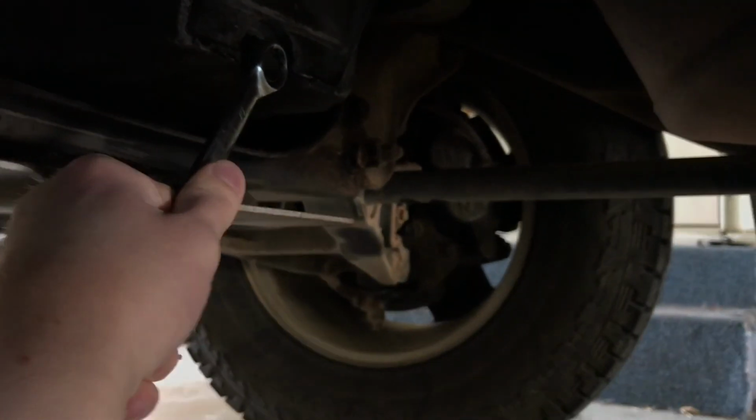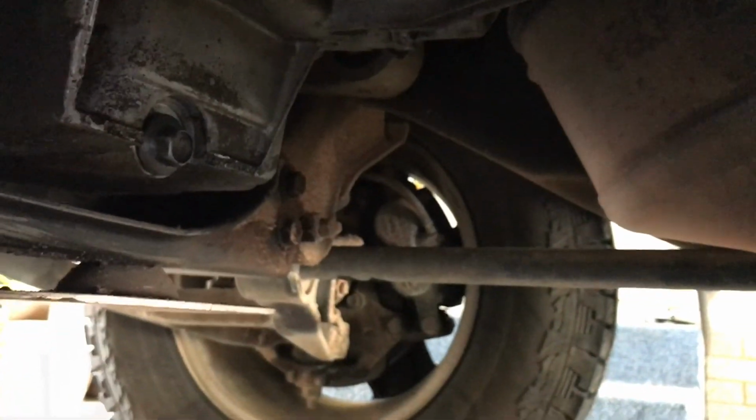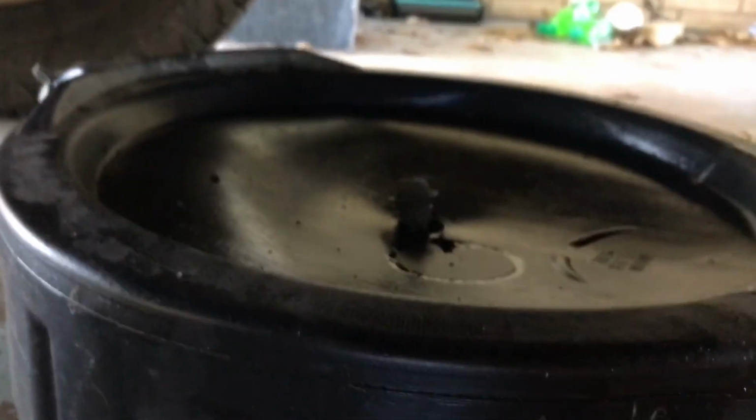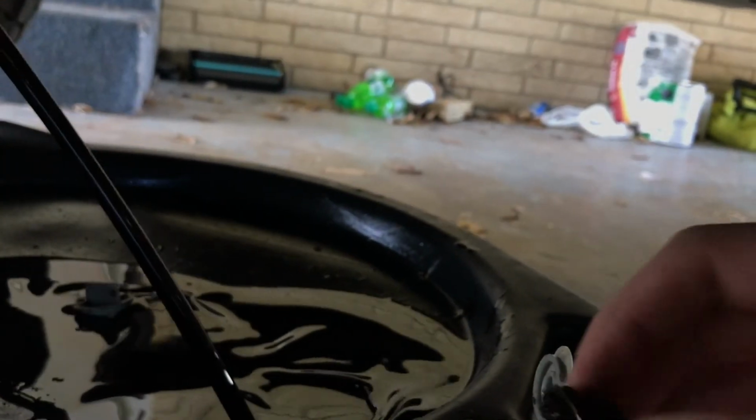And you might watch out too for the exhaust, catalytic converters, everything like that. It's going to be hot if you just ran it down the road. You're going to feel the heat off of it, so be careful. Okay, got it turned. So now it's pretty well broke loose. Let me switch hands here. And this is the trick right here, trying to catch it. So be ready, because it really comes out of there. There we go. Okay, so it's draining nicely now.